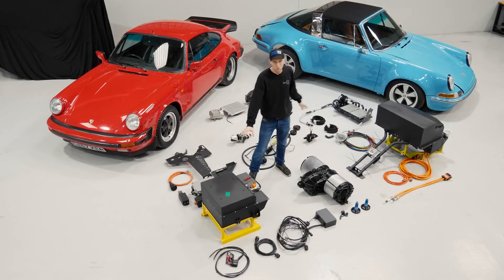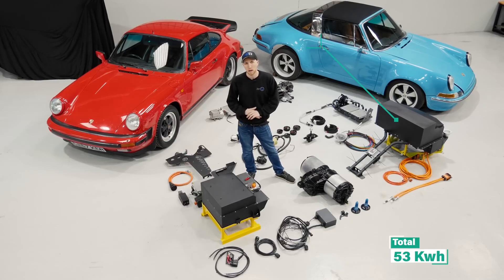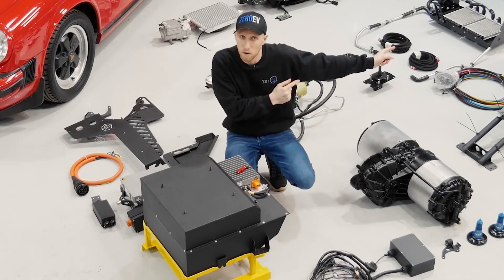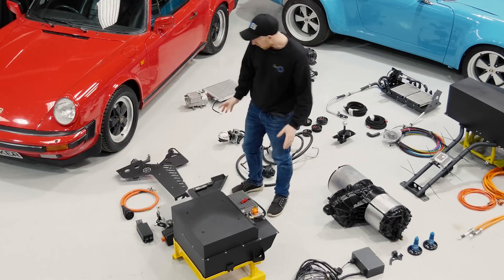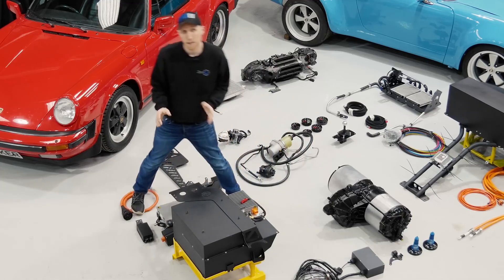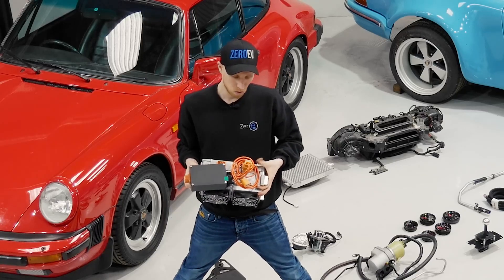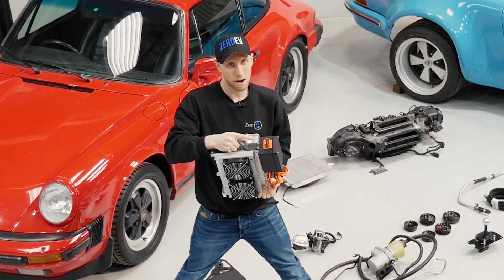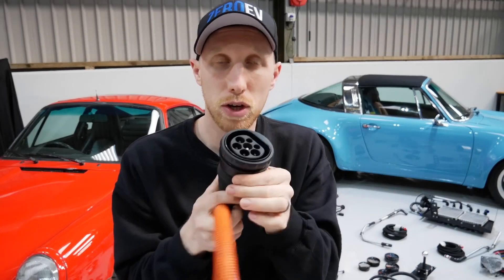We're going to start with the battery boxes — a front battery box and a rear battery box. This total kit is 53 kilowatt hours, built with our CALB modules and our liquid cooling system. On the front battery box we have our battery blow-off valve, a high voltage connector underneath, and a data connector which links to the rear box. We also have our DC to DC converter to keep your 12 volt system topped up at all times. On the front of the vehicle we have a strut brace that ties into the front battery box, which holds our 6.6 kilowatt AC charger that bolts in underneath — all pre-done and pre-terminated with the HV connectors. This is our Type 2 AC charge socket for the Porsche fuel bowl; it goes into the original fuel bowl with no modifications.